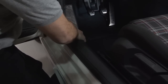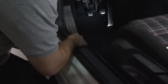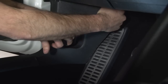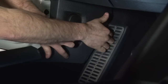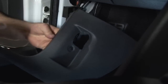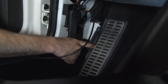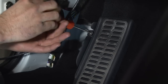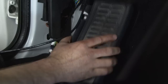This plastic right here can just be pulled up very easily. You don't have to remove it — you just need a little bit of room to get this plastic out. The key to getting this panel off is holding the hood latch back so you can wiggle the plastic around. With that off, it exposes our T25 screw holding in the dead pedal. Now push the pedal up and it will pop right off.